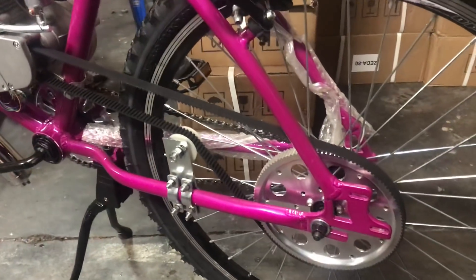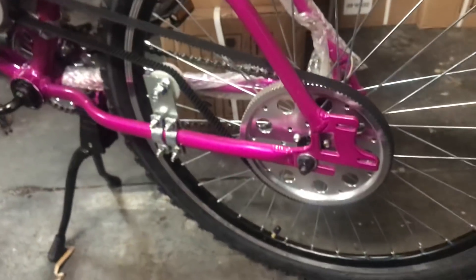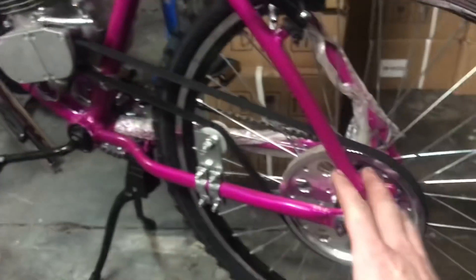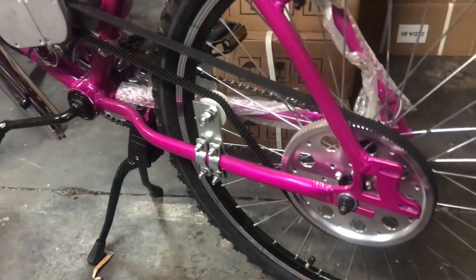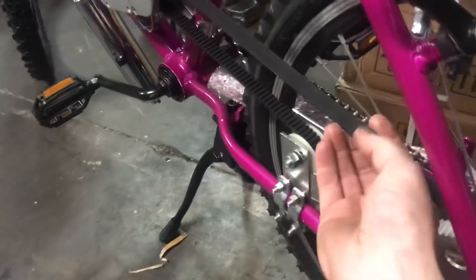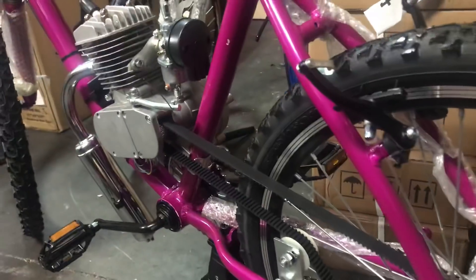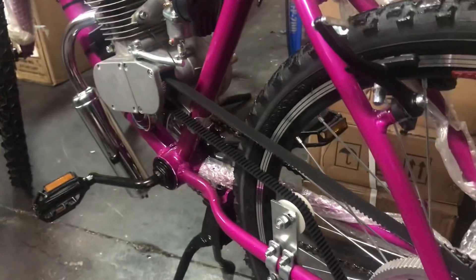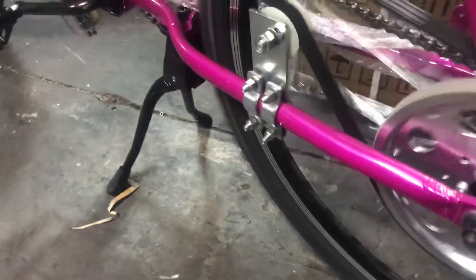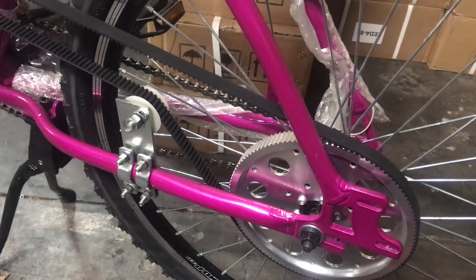This is the all new belt drive system coming out for two-cycle engines. We're the first ones in America to have them and so far we're absolutely in love. The gearing ratio is basically a 10:44 rollout — that's the only gear available right now. It's got a high-grade timing belt. We've been beating on this thing for about an hour and it's amazing — super smooth. Pull the clutch in: super smooth, super quiet. Oh my gosh, so quiet.